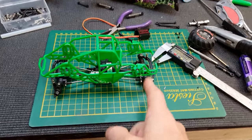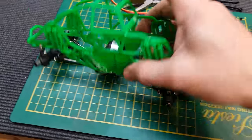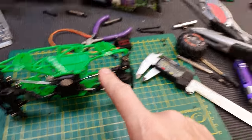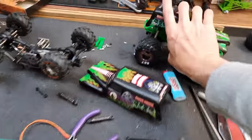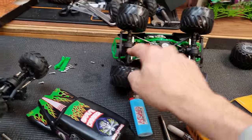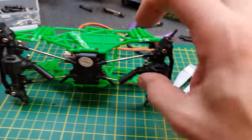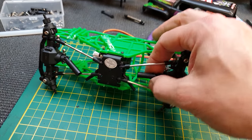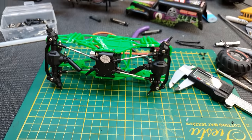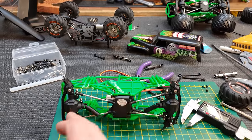In the last video, we mounted the axles — I'll put a link to that video up there if you haven't seen it. The trouble is these axles here are from the RGT Adventurer, and on my original build I used the axles from the HBX Devastator. With these ones, the diff pinion is further inside the axle, so the prop shafts don't fully reach.